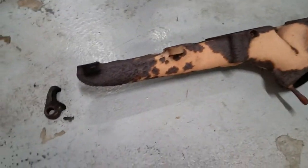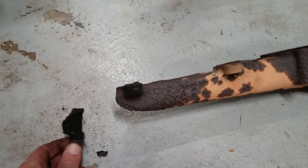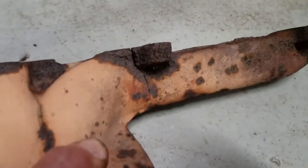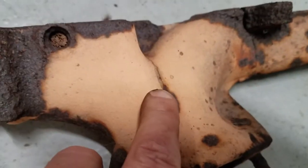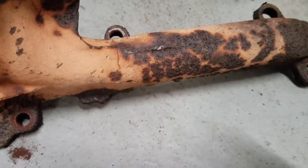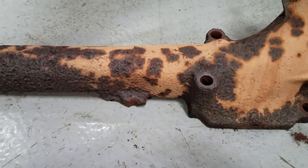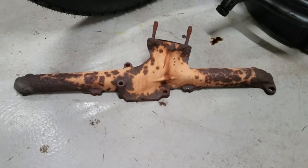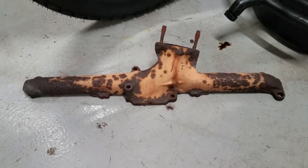The original problem was that this manifold was cracked and broken — you really can't fix that where it is. But after I got it off, it's complete garbage. It's got a crack there that's all the way through, a crack here that goes almost all the way around — not quite 360 but getting there. The ear was broken off, this one too. So it's garbage. I'm debating whether I even want to put another piece of cast iron like this on again even if it would be brand new.